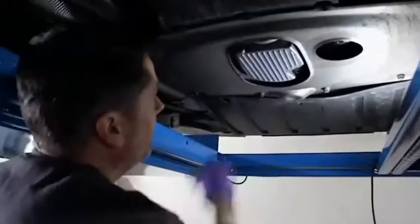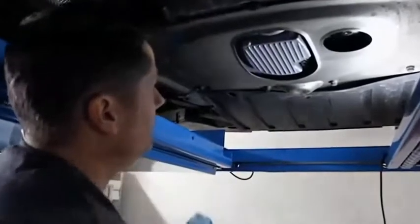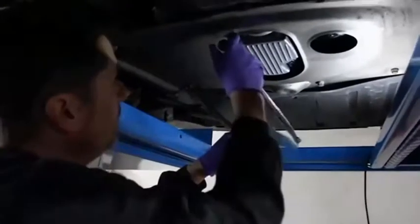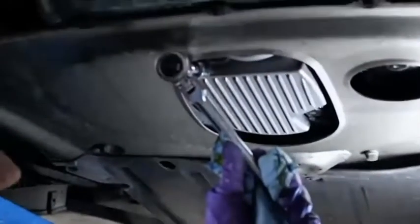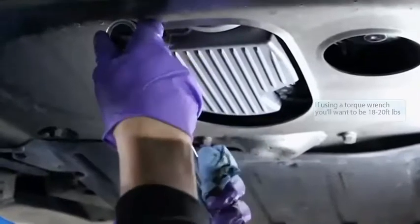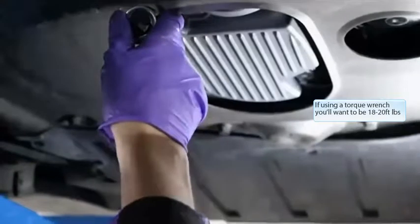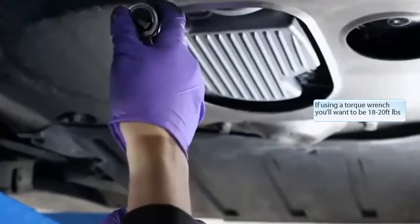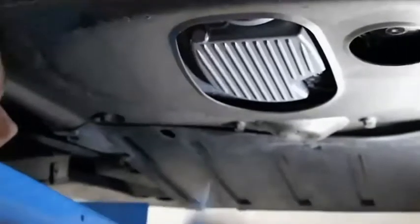You'll put the screw back in — do this with your hand. Never use the ratchet to put the oil bolt back in, because if you do it with a ratchet and the threads are crossed, you're going to damage your threads, and that's never a good thing. Once I've hand tightened it, I clean off any excess oil that might still be lingering in the area from splashes, and then I go ahead and just tighten it. You don't want to tighten super tight or use all your power. Tighten hand tight, then give it a little nudge — maybe one more crank, and that's it.